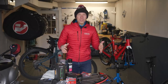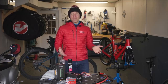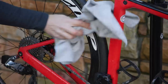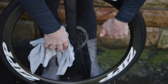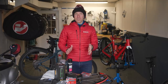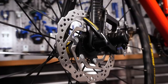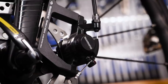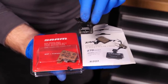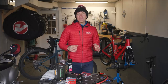Now let's talk about brakes. If you're running traditional caliper brakes, getting a pair of cold weather or wet weather pads is going to help a lot — they'll do better in sloppy conditions. Also consider cleaning the cables or using a sealed system in really wet conditions. There's nothing worse than storing a bike in the cold and finding the cables are totally frozen solid. If you're using hydraulic disc brakes, those cable issues won't apply, and the same goes for electronic shifting. However, disc brake users will want to invest in sintered pads — metallic pads with flecks of metal — which perform much better in the wet, sandy, and gross conditions of winter riding compared to organic pads, which do better in warmer climates.